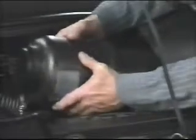When working on driver's side of vehicle, it is helpful to first move air filter for easier access to strut bolts. Using a 13 mm serpentine belt wrench and straight ratchet box end wrench, remove 3 nuts holding upper strut assembly to fender tower. Remove strut from vehicle and install in vise using suitable holder.